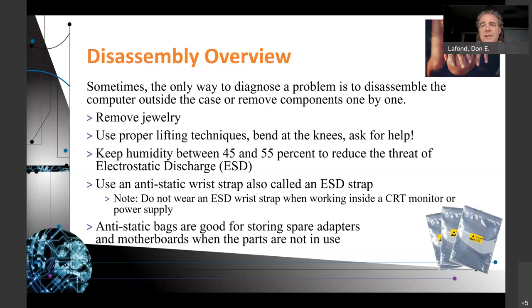Anti-static bags are good for storing spare adapters and motherboards when parts are not in use. You'll usually purchase equipment that comes in these bags — it reduces and eliminates static in shipping and handling. Make sure you're grounded with an ESD strap; you ground it to the case so you are electrically neutral with the case and avoid damage that can be possibly caused by static discharge.